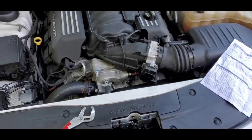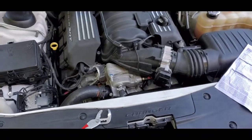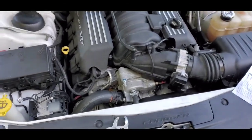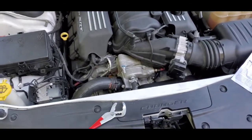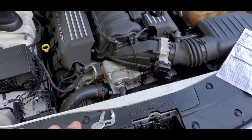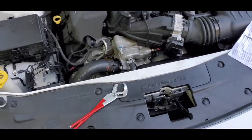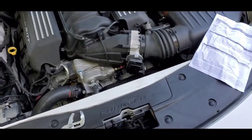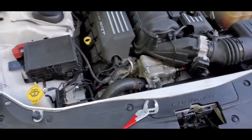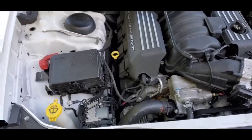They keep your car a little cooler. Your car runs its best at its determined, regulated heat. So it's cool getting a 180 thermostat, which means your thermostat's going to open up a little quicker to cool your car, but it's not going to make much of a difference. My car runs at 208.